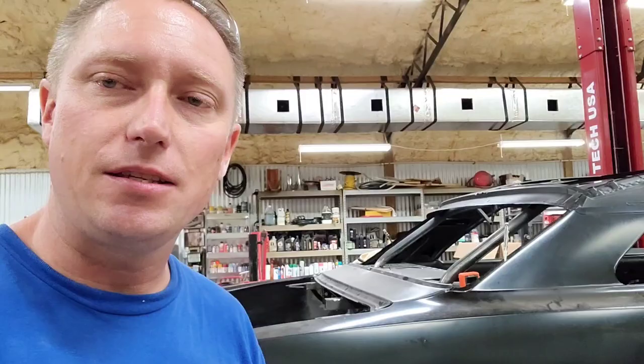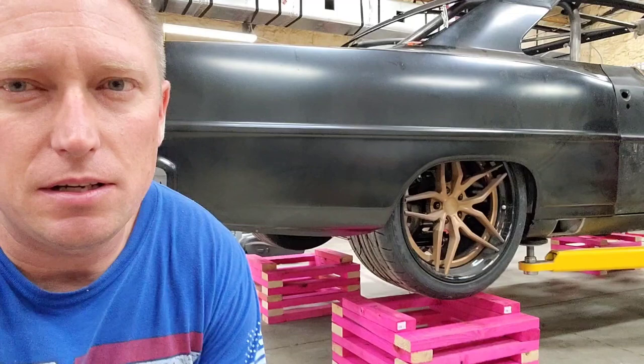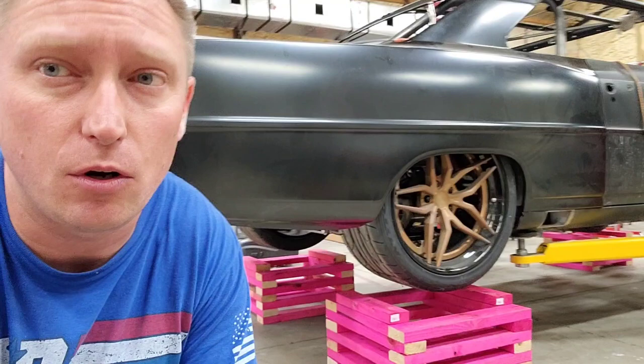Dave said if you build your car sitting on jack stands or maybe on the rotisserie, you weld all the body panels together, and then when you finally set it down on the wheels, all of your gaps are going to change and nothing is going to line up. Big thanks to Dave for that epiphany. You could set it right down on the concrete and build it on the ground just the same, but this is a cheap way of raising the car up a foot or two — however tall you want to make them — getting the car up to a comfortable working height while it's still on its tires. Hope somebody out there has the same epiphany I just had, because that's a pretty big one. Follow along, subscribe if you want. Have a good day.